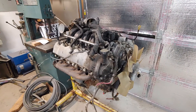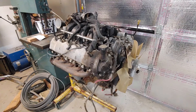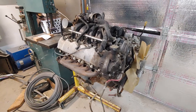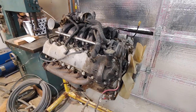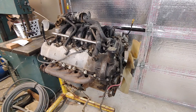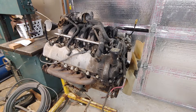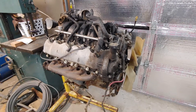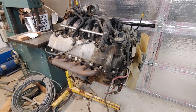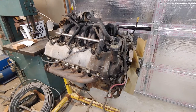There were some obvious signs of the engine not running quite right, and it was clear that the previous owner was not keen on maintaining his vehicles — hence the reason why the tire blew out. On top of that, there was a tick on the left side. I didn't know when I bought the motor that these do not have cam phasers, which thankfully they don't, but there was a tick under the valve cover on the left side of the engine.